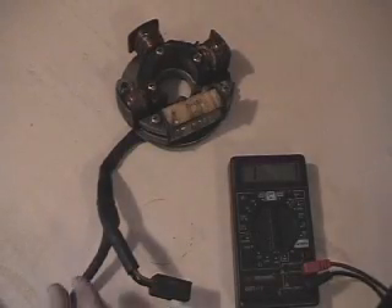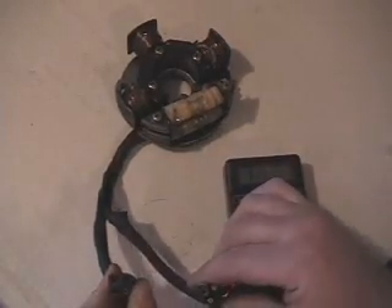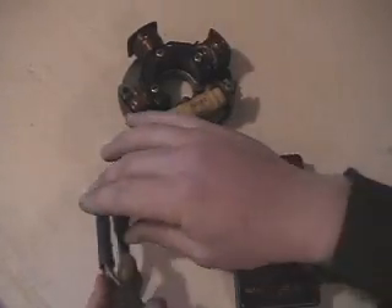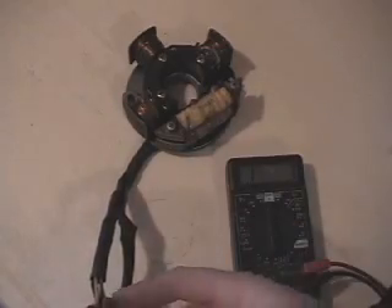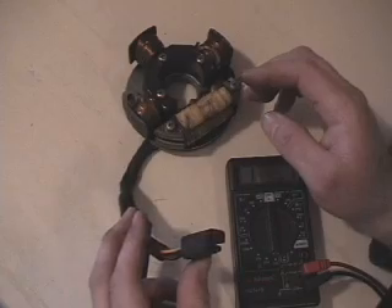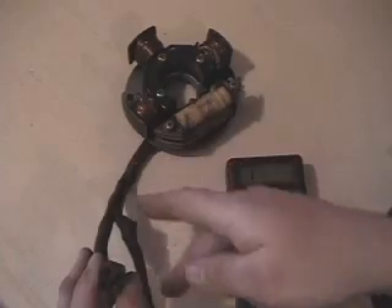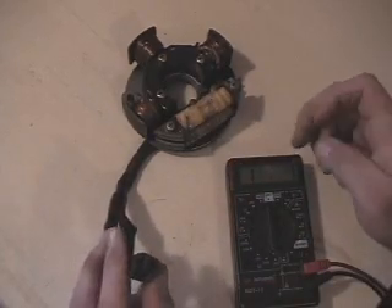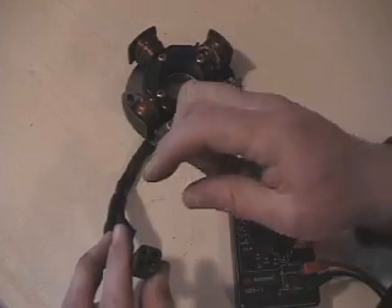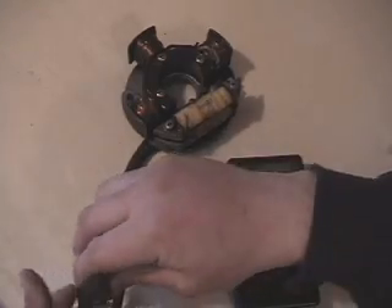On this unit, we've got basically two plugs: a four-prong and a three-prong. The four-prong is our power. We've got two yellow wires on the back side, and those are your power. The other two are for ignition, just for turning it on and off. You've got your ground here — there's a ground that runs down through the harness and comes back up to the other side. This is the four-prong where you can go ahead and jump it.